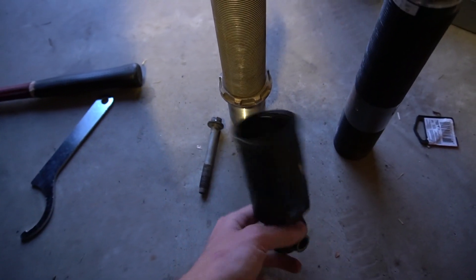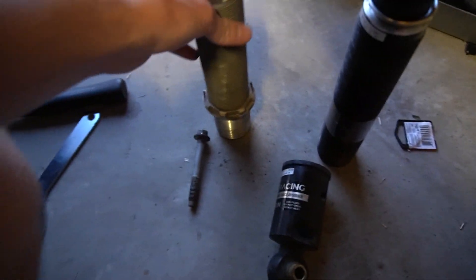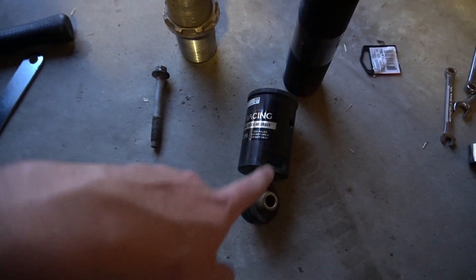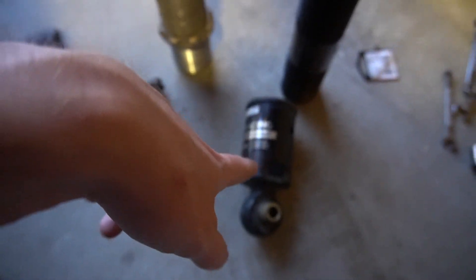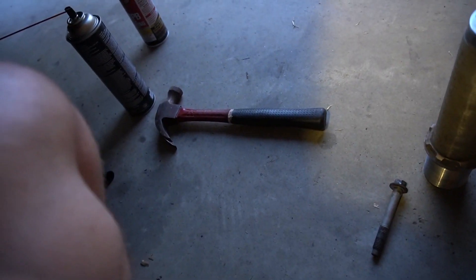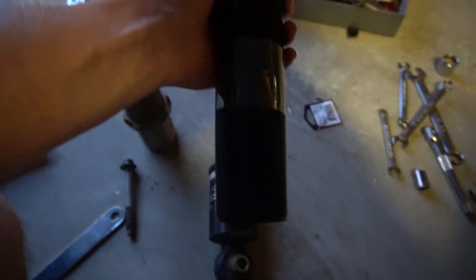I don't think a breaker bar will work — you need some impact tool. You need your spanner wrenches, which hopefully came with your BC kit. If not, you can order new ones. You also need an impact-specific socket — I couldn't get my chrome socket to work. To undo the damper from the base — I'll call it a cup — it's regular lefty-loosey righty-tighty. Loosen it while it's still installed in the car, before you take it out. You'll definitely need to whack it with a hammer.